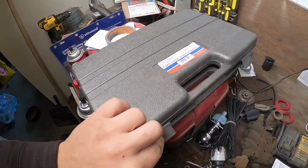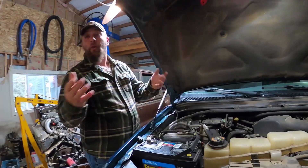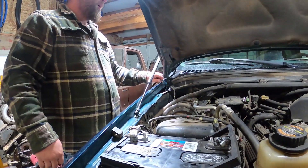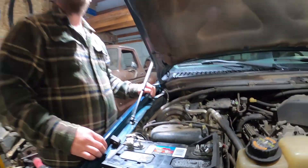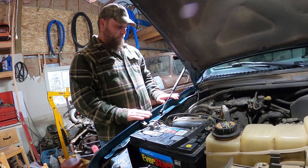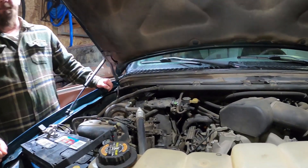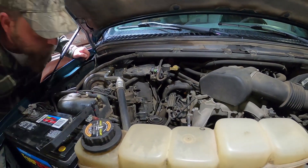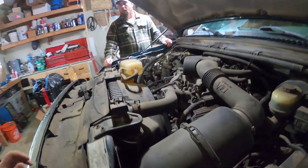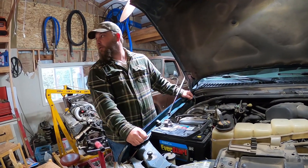This thing came with a Ford Triton insert installer kit, and Kyle's already watched the video — the first part anyway. So we're gonna play along with those guys and how they do it. We've got to make sure the cylinder is at the very bottom of the stroke. We don't have our borescope cam at the moment, which sucks, but we're gonna do that off camera. And if you're tuning in for the first time, subscribe — we are a Ford channel, we have all 19 models from the 1970s all the way up through the early 2000s.